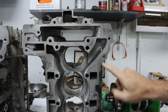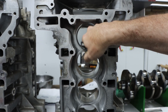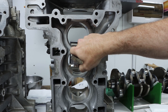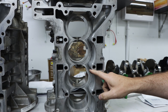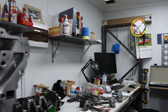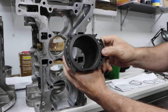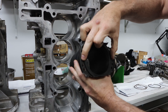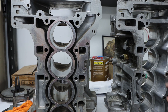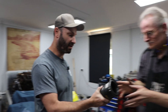Here's a block that we've had machined. We've taken out the top half of the liner down to the base of the water jacket, and we've taken some material out here to slide our liner in, which has some O-rings on it to seal the oil from the water. We've done some machining around the deck here for the wings of the liner. These wings allow a tolerance fit of about half a thou — we cool the liner down and heat the block up to install it, and when it all cools it locks together, giving the liner stability compared to the standard liner which has nothing.